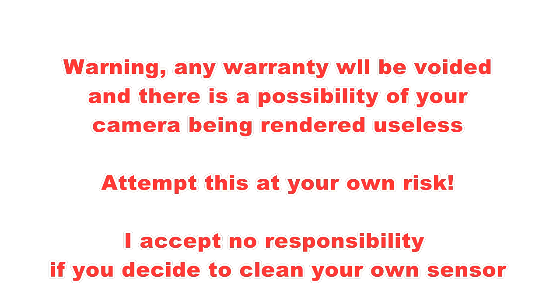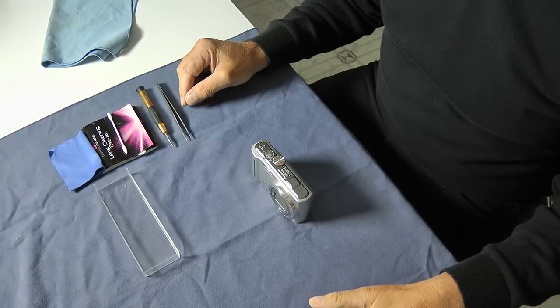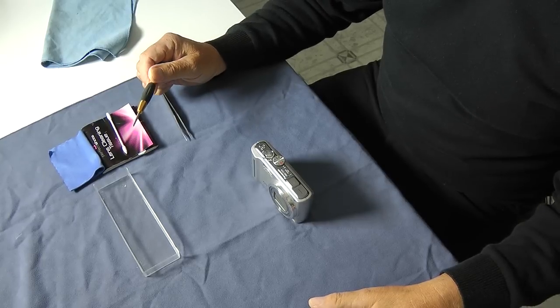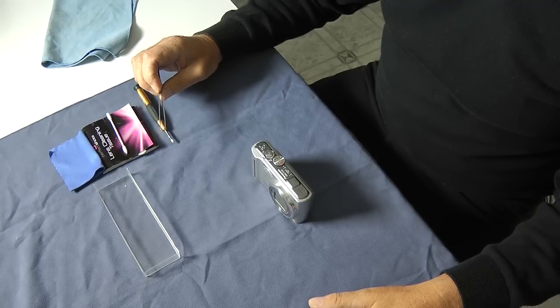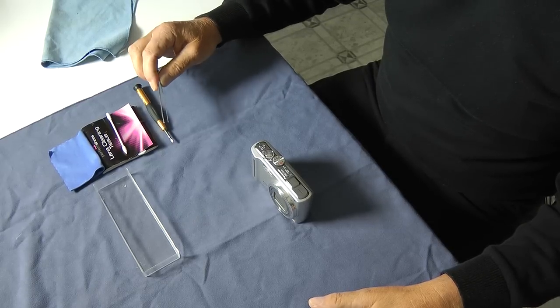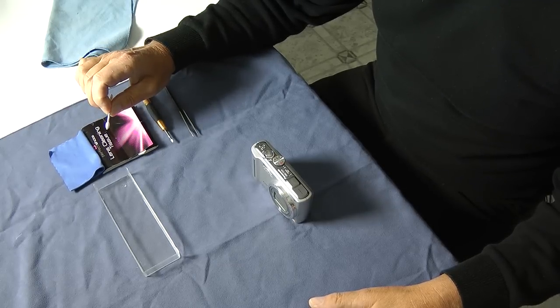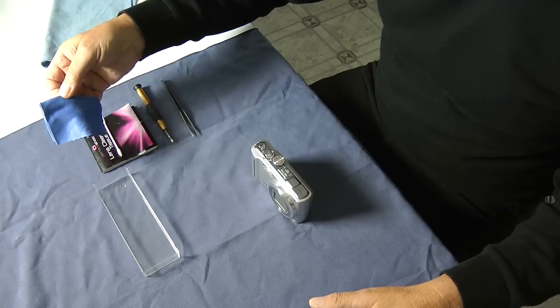You must be aware that you can damage your camera if you attempt this without the requisite skills. To disassemble this camera you'll need some specialist tools. The first thing you'll need is a number zero cross-point jeweler's screwdriver. Optionally you'll need a pair of tweezers to handle the small screws — they're not absolutely essential but they do help. To actually clean the sensor and the infrared filter, I prefer to use cotton wool buds, or you can use lens tissue or a lint-free lens cloth.